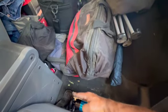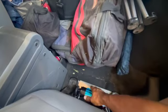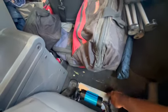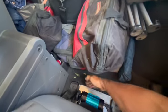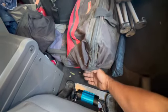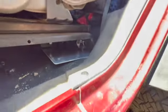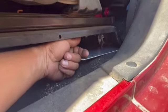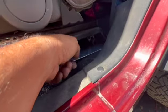I run the back of my seat to about right here, and stuff could fall in and sit up against this compressor — when these things run for a minute they get pretty warm. So I think what I'm going to do is come off of here and make a little L-bracket that sits right in this area, so when the seat is in place nothing can fall and lean against it. For now temporarily, the air chuck port I'm probably going to make a little bracket right here and put it on, and then you'll just plug the hose in right there.